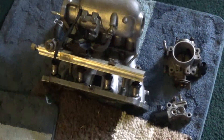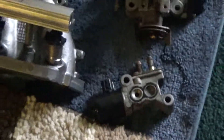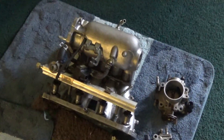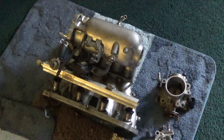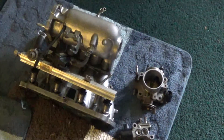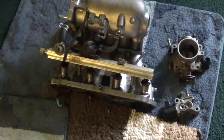Here's my intake. I'm doing a D16Y8, and right there we got our throttle. I gotta clean that up - pretty sure that's a bad idle air control valve. I got on Craigslist and worked with a buddy of mine and picked up an engine that went through a swap - somebody put a B-series engine in and left this one. I picked it up for under $200, maybe $100-150.